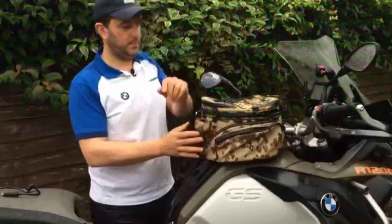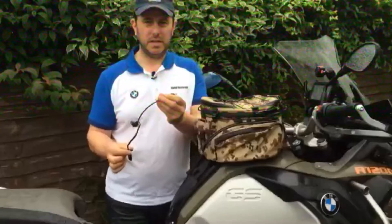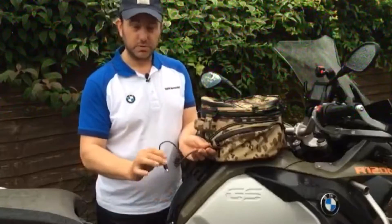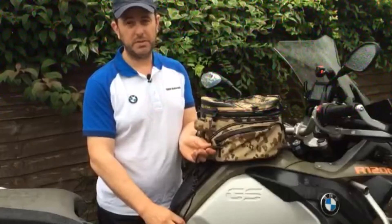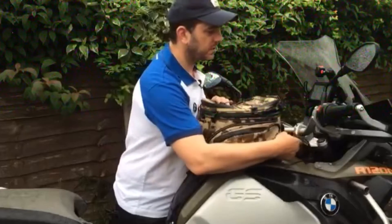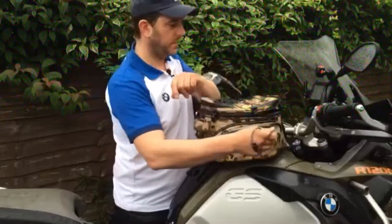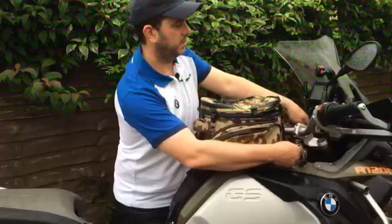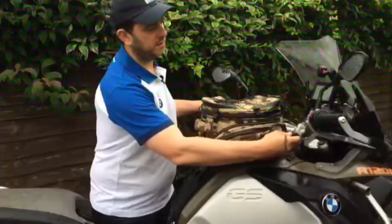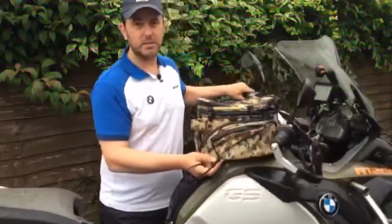Okay, now that's your attachment lead or your fly lead. That goes from the tank bag itself to the main harness, which is feeding it from the battery or the distribution box. Now initially you could have put it up the front here and led it down, like on some older GS's, but because it sticks out that much it's going to hinder the bars if I do it on this side or that side.